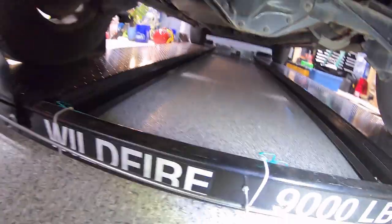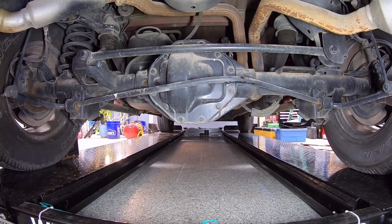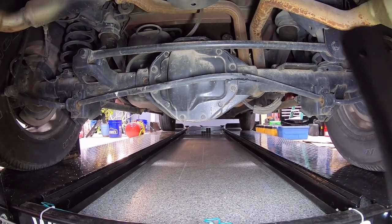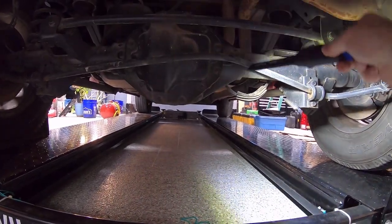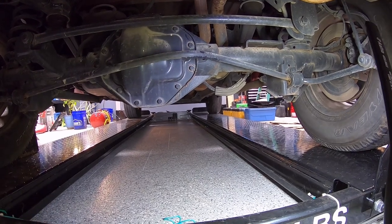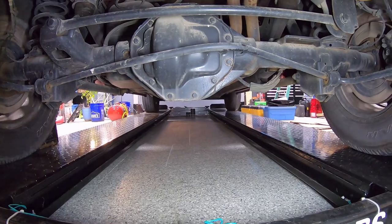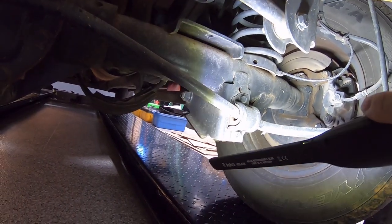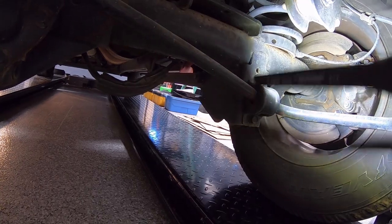The first thing you'll notice from the back is the sway bar on the rear axle — it's twisted like a pretzel. It should not have that bend in it. If you follow the piece, it comes up, goes down, goes back down. It took one heck of a wallop on this side to bend that. You can also see the bushings — there's a gap at the bottom where the bar has been bent upward, pushing everything up.